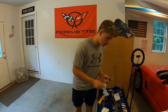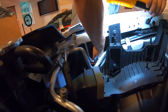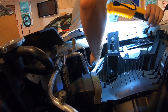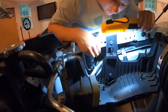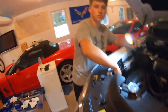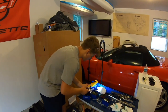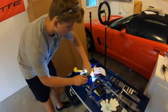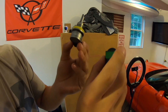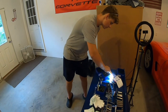Before we put it in, put your gloves on. Moving on to the low beam — you want to put your thumb in here, push down, push on the connector, disengaging it and then sliding it down. Once you've got that off, you're going to want to turn counterclockwise just like the other ones, and there's your low beam. Put the low beam back where the new one is coming from. Just double check them — this one says H11 here and on the bottom says H11, so we're not mixing them up.